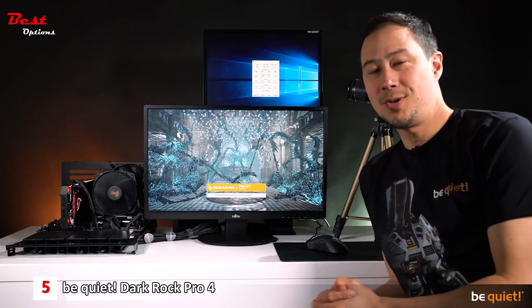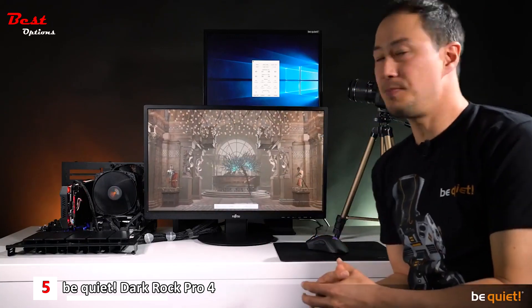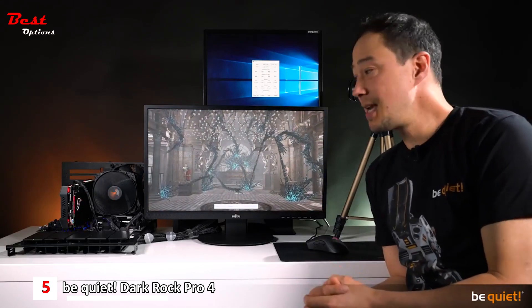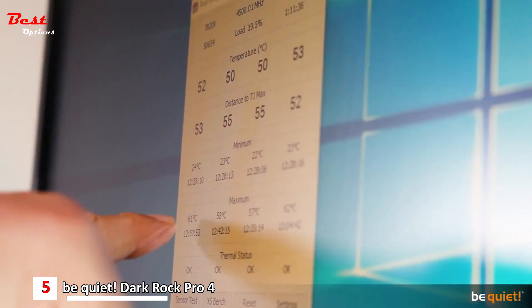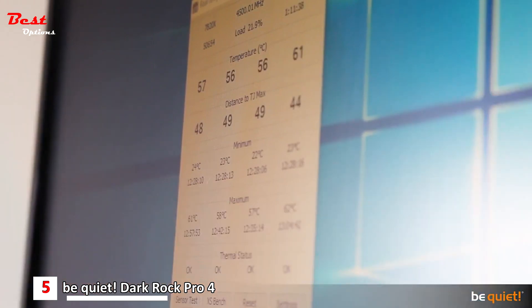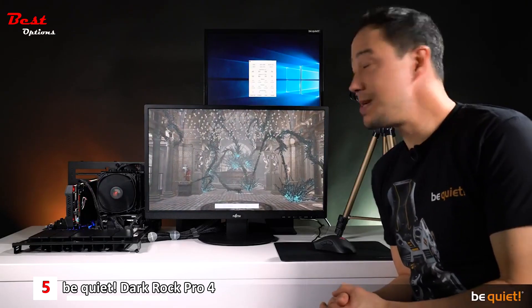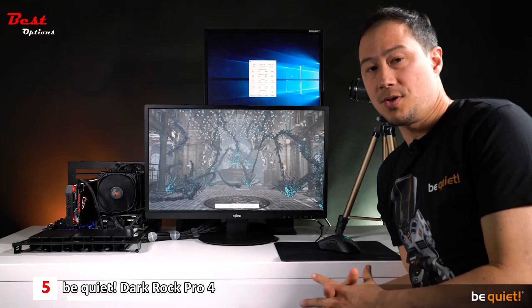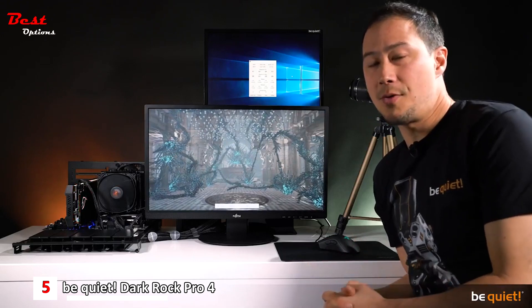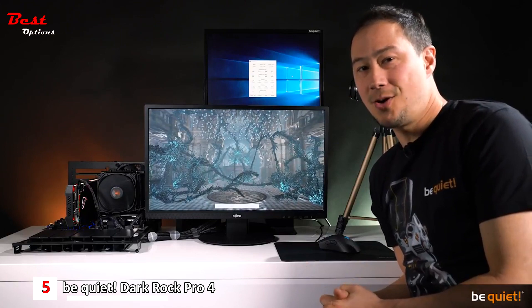It's 22.1 degrees — perfect for a performance test. We use the TimeSpy CPU load test with an i7-7820X CPU without any extravagancies, which results in maximum CPU temperatures of about 60 degrees Celsius for the Dark Rock 4. The Dark Rock Pro 4 goes even lower, resulting in about 57 degrees Celsius maximum temperature under the same conditions, proving its superiority. Needless to say, both coolers remained amazingly quiet the whole time.